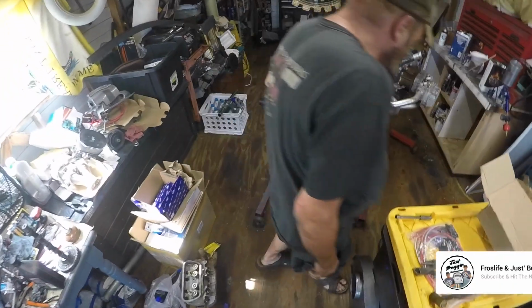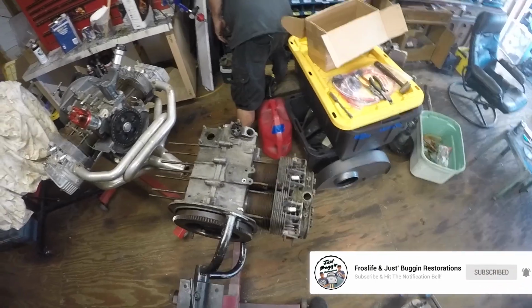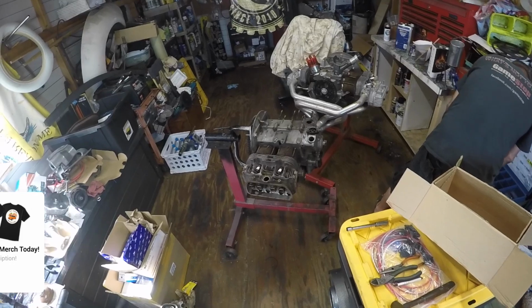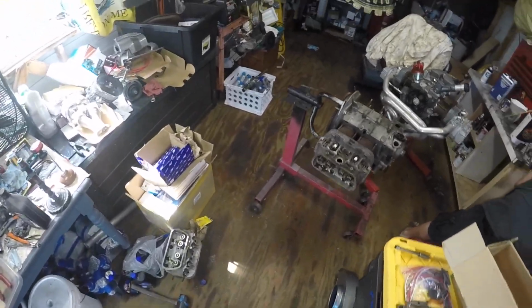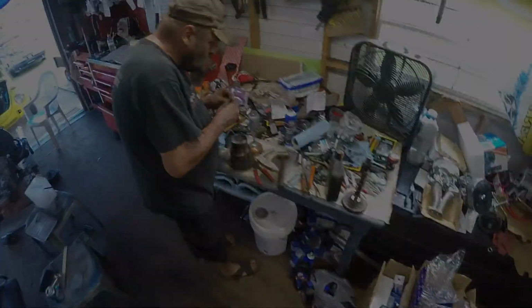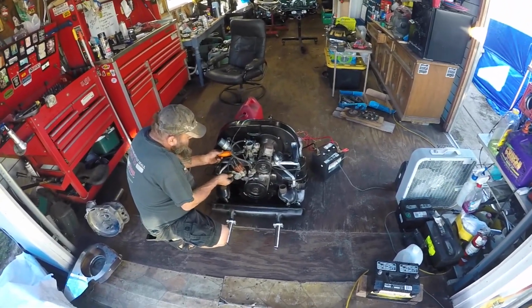All right, we got two new pistons in there on one side now, huh? Yep. I'm curious to see what we increase the compression on this low budget build here. Luckily it's only 55,000 miles on it, so it should be just fine for the purpose. Okay, here we go with the last new piston, huh? Yep. That'll work. Should be a decent runner there. Got lucky there. All right, let's get tuning it up and get ready to put it back in the 65.